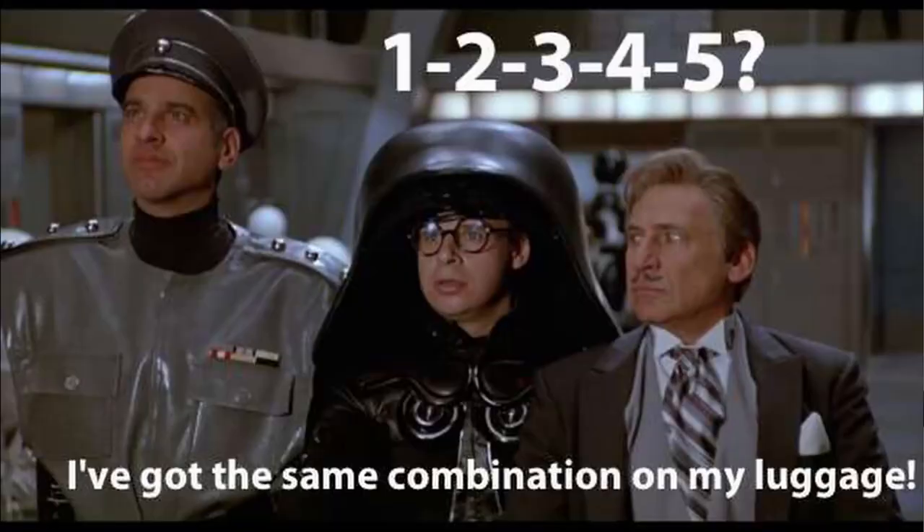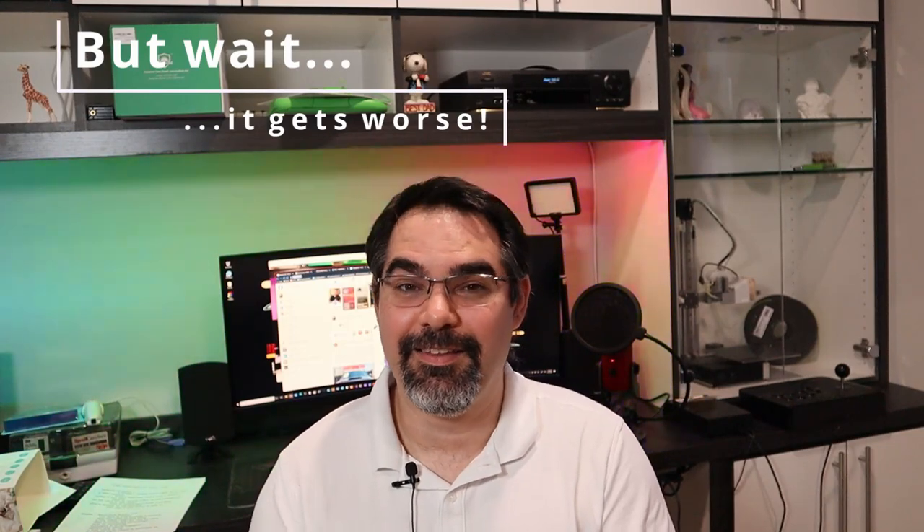The final nail in the coffin for this camera, as far as I'm concerned, until we get a firmware upgrade: the camera has a default password of 1-2-3-4-5, just like your luggage. And that password is not changeable. It has a hard-coded username of admin. So the account on the camera is hard-coded, unchangeable, and exposed. The other part of this is it comes with an offline setup which would allow you to set the camera up without hooking it up to the internet. Maybe if I squint I can make this camera be okay — but the offline setup didn't work at all. I looked at other reviews and saw this a number of times; the offline setup just seems to be broken. So you can't offline setup, which means the only way to set it up is to create an account, which cloud-connects the camera, and then it has a hard-coded password.